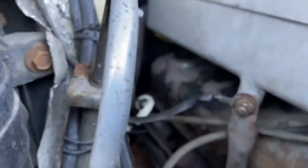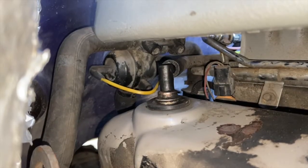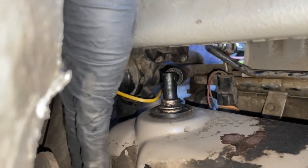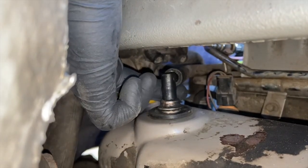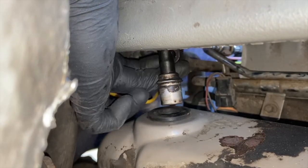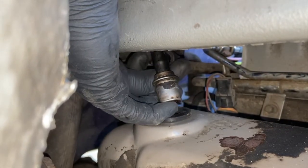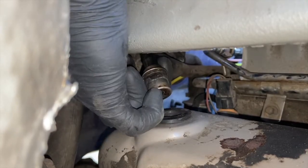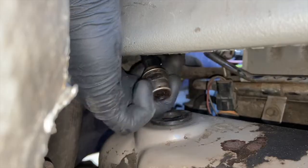To replace it, we're going to go right back in here. There's your PCV valve coming out of your valve cover. You're just going to reach back here with your hand — palm's going to be on the back side of the intake — then put a finger under that end and around this side and just pull right up. It comes right out. And there's the tube right here on the back side; you're just going to pull it out of that tube.